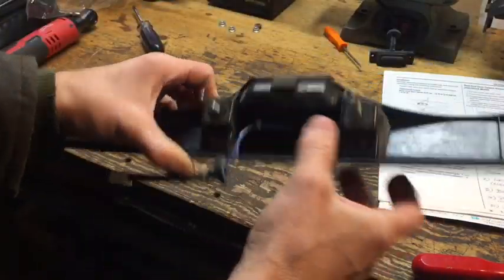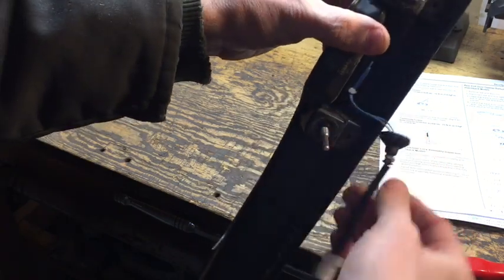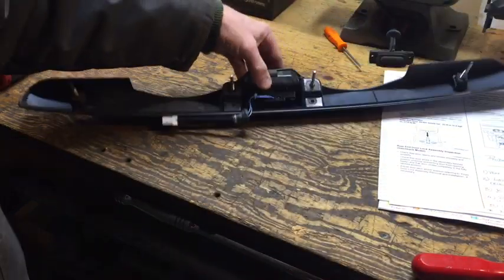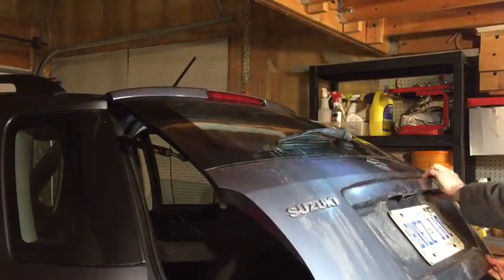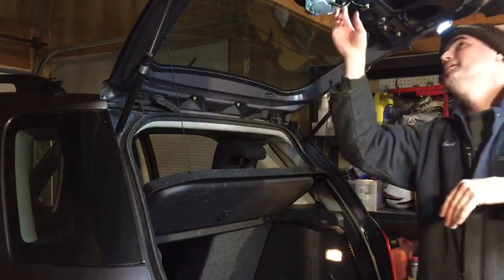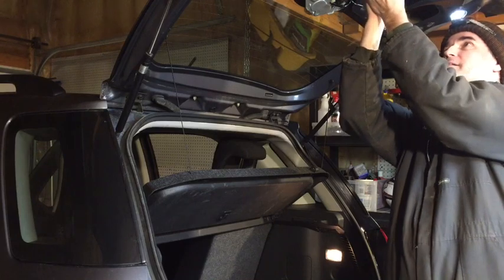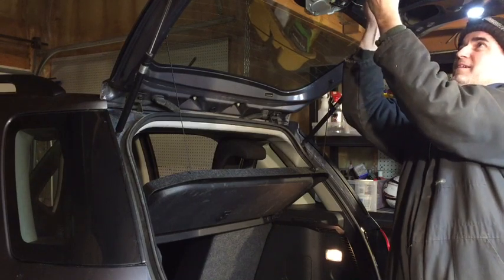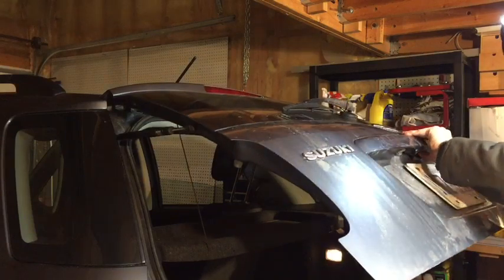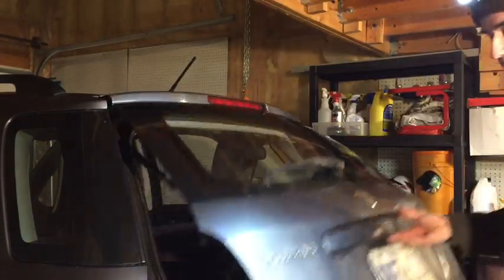It's sub-assembled - everything back on the car. Just feed the wire harness carefully, position the grommet in the skin of the door itself, and the four studs of course go through the corresponding holes. Grommet's in place, everything's secured. I hand-tightened everything so I don't over-torque it with the electric ratchet. Connector back on its female companion - actuator everything's hooked back up.